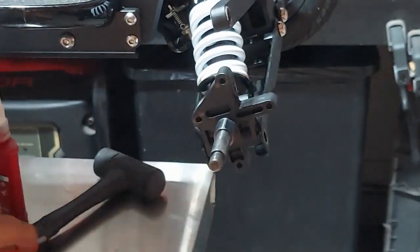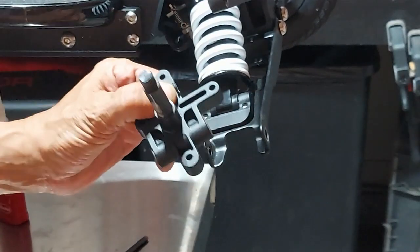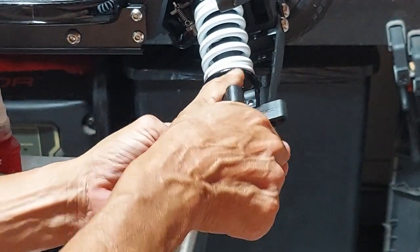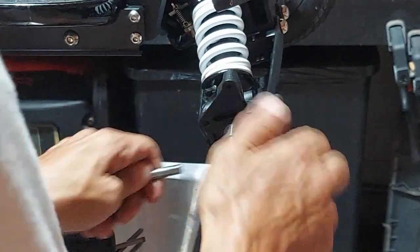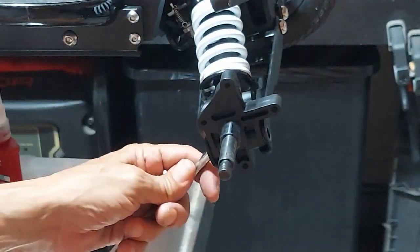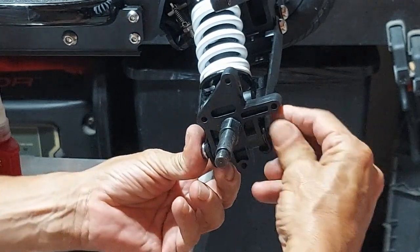And that's it, basically you're free. To get it out just take your rubber hammer and give it a little tap - it's just kind of set in there a little bit. You get the new one you're replacing it with and fit it right in there just like that. Let me get this bottom bolt in real quick just so we're stabilized. I like to stick the Allen head through and give it a wiggle - it kind of lines up the holes a little bit. Put that in and just get it going for a second.